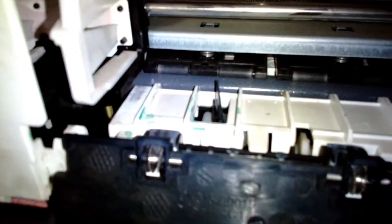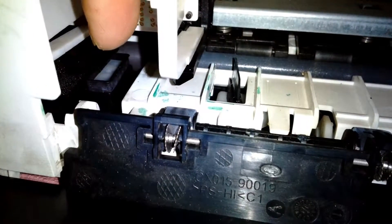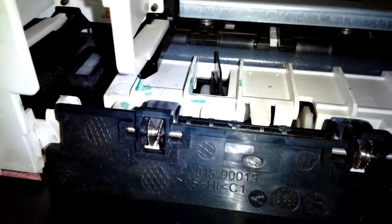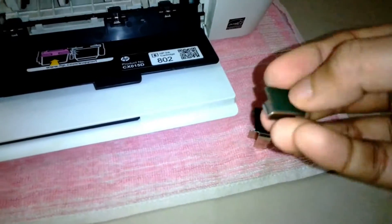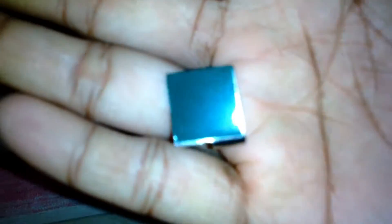There is a small flipper inside the printer that cleans the cartridge when it moves back and forth, but goes down while printing. On the left side when the printer is idle, there is a rubber boot which seals the print head surface. As the carriage moves from right to left, the boot automatically lifts and attaches itself to the cartridge print head. I need to fix the rubber tubes in such a way that they do not jam the carriage, otherwise I will get a carriage jam error. These are the clamps from the kit and I need to think something out.